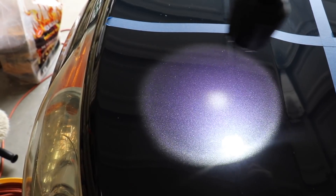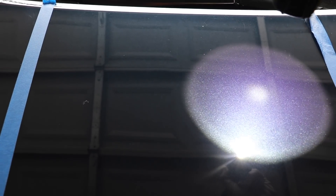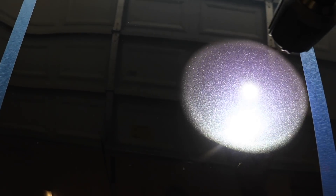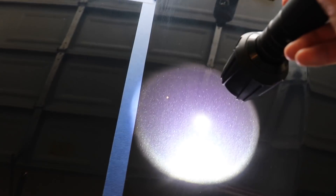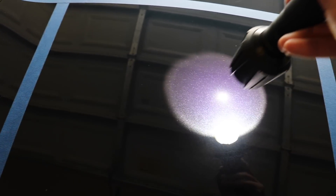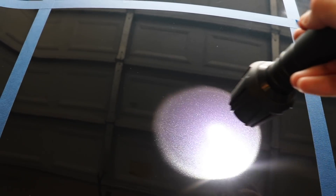Let's run through all of them. The 1000 with the rotary alone and wool pad still looks fantastic. The 1000 and 2000 still looking very, very good — still some buffer tracks, but as to be expected. Finishing with the 3000: 1000, 2000, 3000 — and it just looks pretty much perfect. Then here we've got the 1000, 2000, 3000 finishing with the liquid carnauba wax — just looks fantastic. Now here's the panel that was not corrected at all — tons of streaking, tons of swirl marks and imperfections. And then you come over here and see this perfected surface finished with that liquid carnauba wax — really looks fantastic.